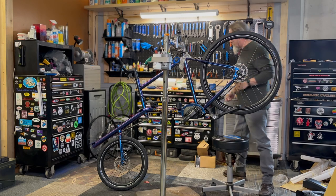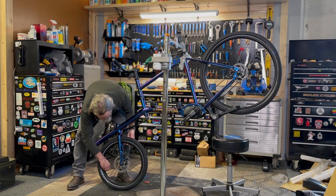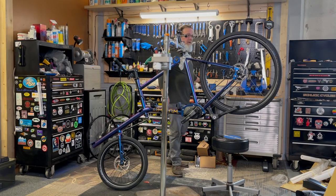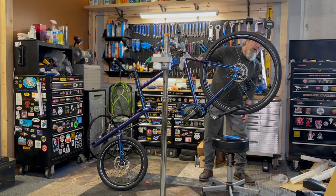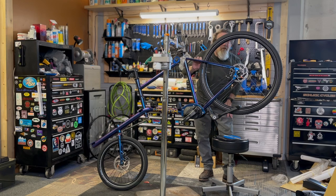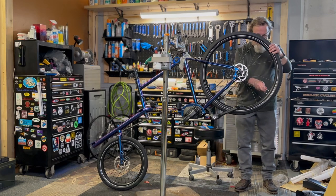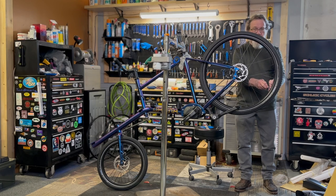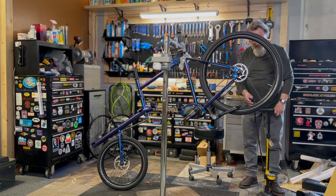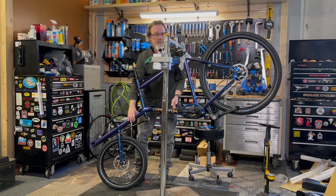Tires do need air. These tires, what do they like? Milwaukee is quite the potholy city, so I typically run them a little softer than full pressure, 30 to 55 on these. Around 40 pounds would probably be pretty good. It's nice having a little cushion, but you want enough air there where you're not going to have a problem with pinch flats or whatever. But the nice thing about the volume of air on these tires is it doesn't take that much pressure.